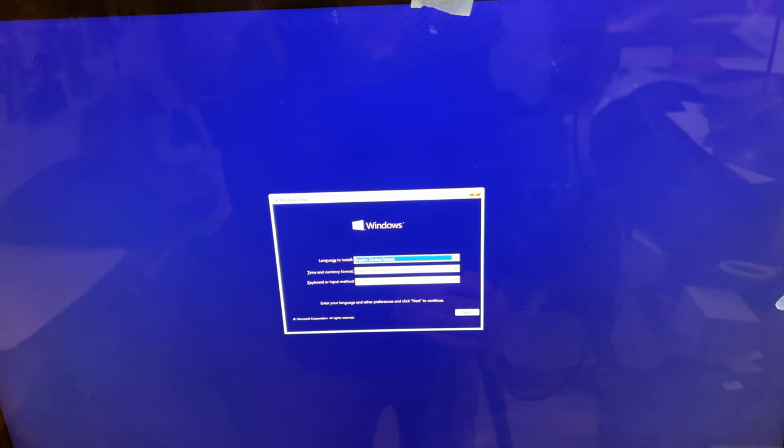Well, let me go get another keyboard, and I'm going to see if I can boot into the system option here. So, be right back. Okay, so an update. I plugged in a regular Apple wired keyboard, and I went into Internet Recovery, put in the Wi-Fi password. It's doing it. Then it'll take me to the next screen where it'll say, okay, what do you want to do? A new OS install or a Time Machine backup? And it's not seeing any of the drives. So there's something goofy. I forgot to plug something in, or there's something wrong with the machine. But it seems to be working fine. Now, I notice I don't have any sound, so I'm not sure what that's all about. So anyway, gonna do an update here, and I'll be back in a few minutes.